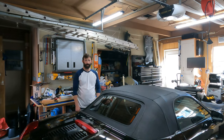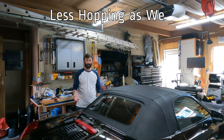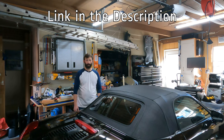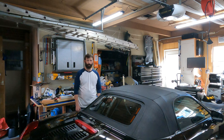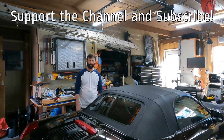I know we had some fitment issues right off the bat getting the part on the car, but with aftermarket parts that's very normal. Toyota's build variance is enough to cause a problem like that when the bolts go through a sleeved portion like in that breastplate. As far as the test drive, I can already tell a difference. It feels a lot like when I added the strut bars — the car sitting up more when you steer, and the steering rack feels even tighter because there's not as much flex in the body. This car already comes with a really quick steering feel, so to further improve that is just awesome. I really enjoyed the part. I'll put a link in the description if you want to purchase one and support the maker on Spyder Chat. If you have any questions, please put them in the comments below, and please like, share, and subscribe. I'm always glad to learn something new. Thanks.